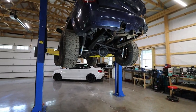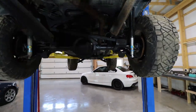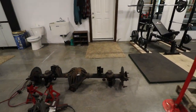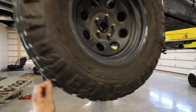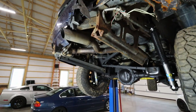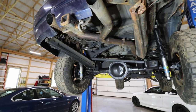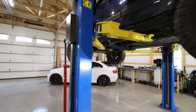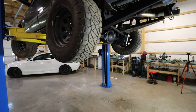I've got the rear axle in, and that was far from easy especially doing it by myself, but I'm glad I got it in. The old one is out — the old bent one is here. It looks pretty good. The wheel is actually straightened out and everything actually spins, unlike before. There's still some work to do under here, like this rock slider piece needs bent back in place and then painted as well. That's it for today. Next time I'll be moving on to the front and get the steering figured out, and then I should be able to put this back on the ground and try to drive it.